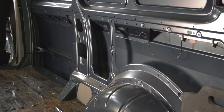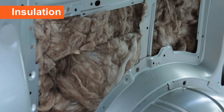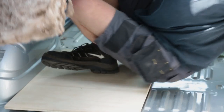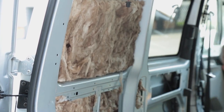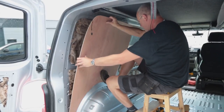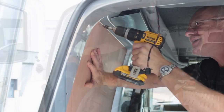The van's walls also need to be insulated. You need insulation in a van for sound deadening purposes but also to keep yourself warm in winter. We personally just use earth wool — we don't use anything else because we find you need the panels to breathe. So if you take a van apart for any reason in the future, it's all nice and dry inside, and effectively that is all you need. Then we re-panel the van with panels that are all properly screwed to the van, and then carpet on top.